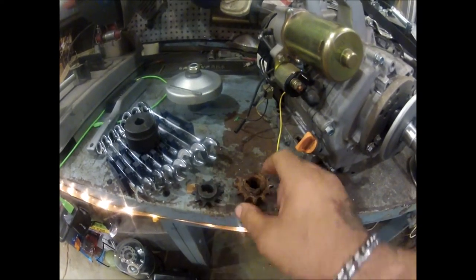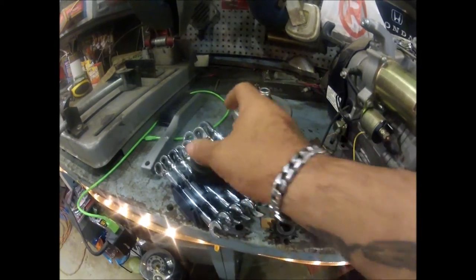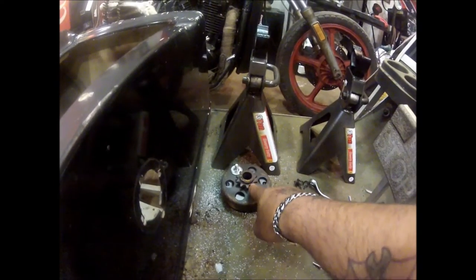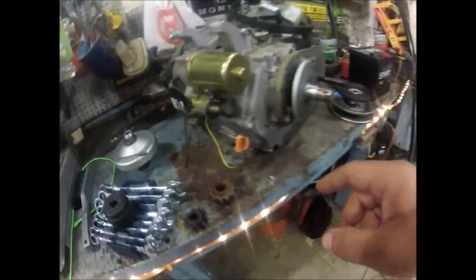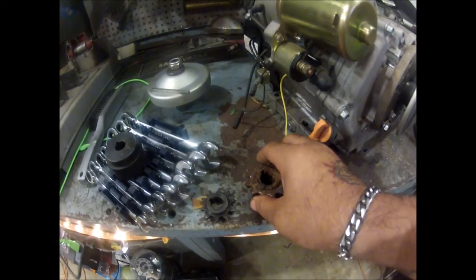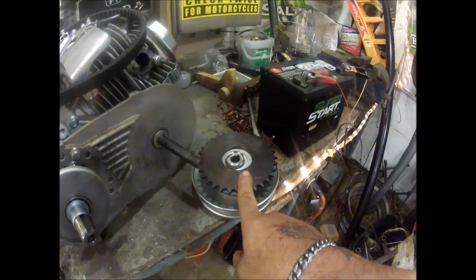I had kind of the same scenario on gearing. This is the rear gear I had made — it's nothing more than a hub and a sprocket welded onto it. Here's a 12-tooth centrifugal clutch that was on this 6.5 horsepower Predator motor, turning this 12-tooth gear. I wasn't getting very much difference in gearing and was doing approximately 5 miles per hour. So I figured I either need to go with a smaller gear on the rear or a bigger gear on the front.